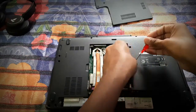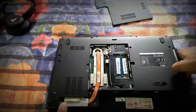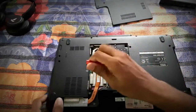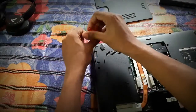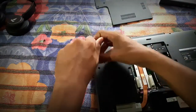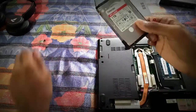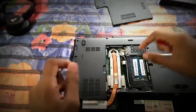After removing it, take the screw out. Now you can remove this CD-ROM drive out. After that, you have to come here and you can just remove the hard drive. Just remove the 2 screws holding the hard drive, then you can just slide this hard drive out. You can see it's from Toshiba. After that, you have to remove these 2 RAM sticks.